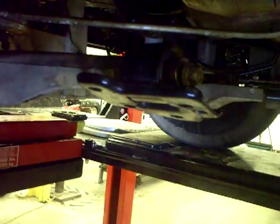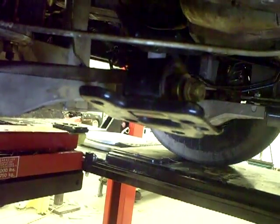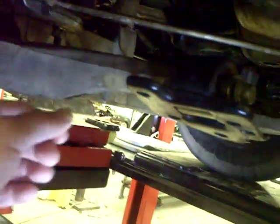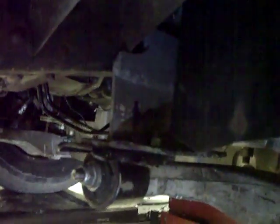The problem is with a design I based off the gentleman when he done his. I can't say it's his fault because I'm running the truck up higher than he is, but I based my brackets off his brackets. Because I jacked mine up higher, I had to make my brackets longer. The brackets hook up to this right here — let me go to the other side to show you how we done it. He done his pretty much the same way, except I had to make it longer. Because of that, it bent whenever we applied the brakes.